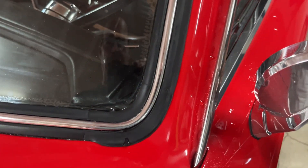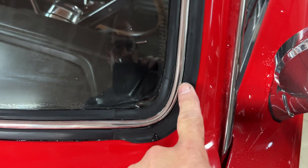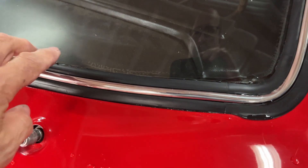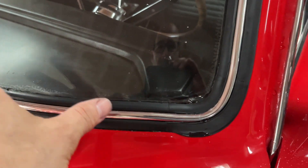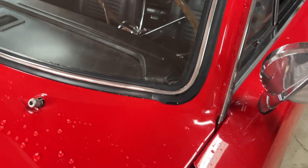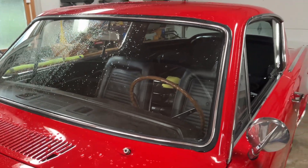What I ended up doing was pulling the lock strip back out. I had done a bead down here and put more on the outside here, then peeled this back and put some inside. Squished it all in really good — good squish — and then put the lock strip back on. And now it seems fine. I water tested it real quick just before the torrential rains hit outside, so I got the car back in the garage.